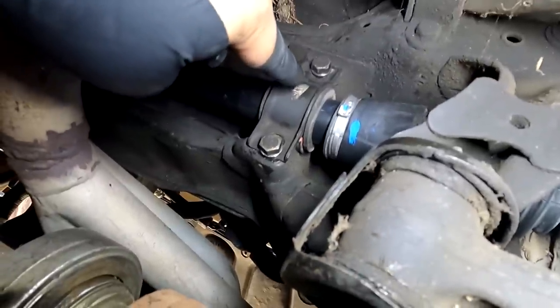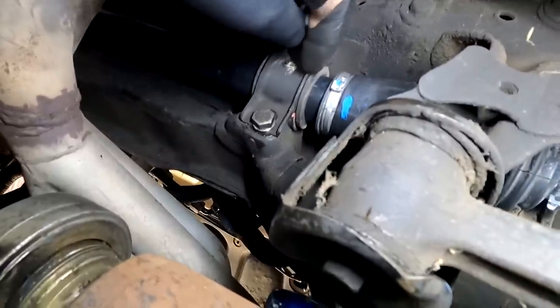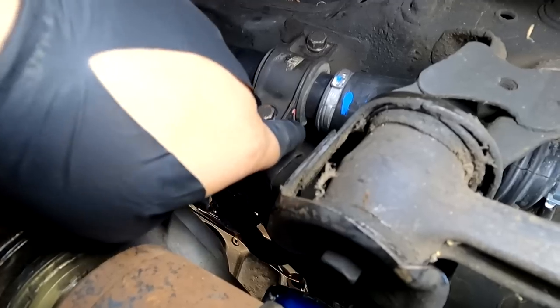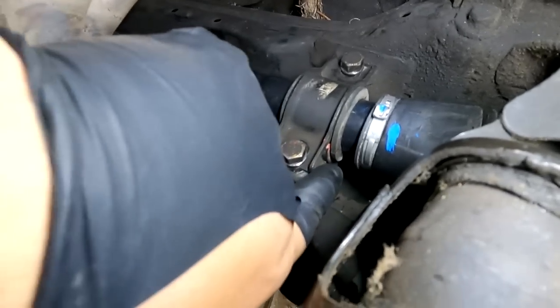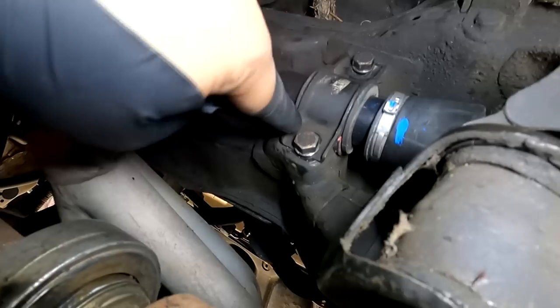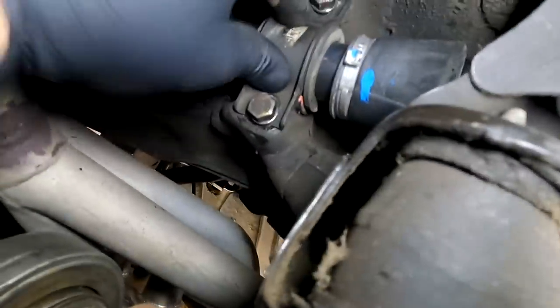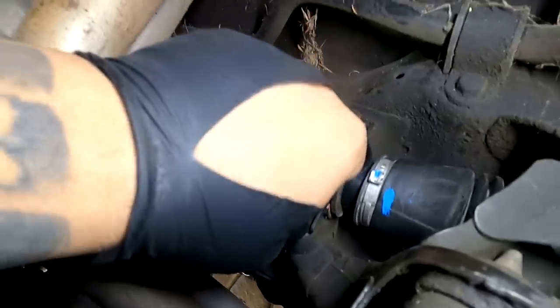Sorry for being upside down, guys, but right here we have the manual steering rack bracket and bushing, and like I was mentioning earlier, that fat gap on the top, because the subframe is meant for the bigger bushing, I took one of the silicone couplers and slid it to the point where it compensated that gap. And then I was able to bolt the bracket down after slicing the ends off. You can see how the hole is over here, but I don't think it's gonna move anywhere. It's pretty firm on there, and I think that's gonna be good.